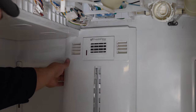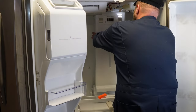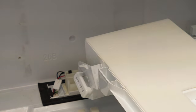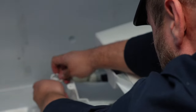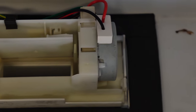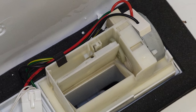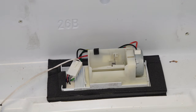Once the panel is off, the air tower is fully exposed and you can see the lip of the air housing that was hidden under the cover — you can now remove the housing. On single evaporator models, you'll first need to remove the sensor cover integrated into the evaporator panel, press the clip in, thread the white thermistor into the air tower, and then remove the air tower assembly. All you're going to find in this particular unit is an air dampener and the sensor system. This damper opens and closes to allow airflow into the refrigerator cabinet. If the damper is not working right it cannot open or close, causing no airflow and therefore no cold air. We will want to test and then replace it if needed.